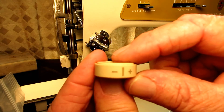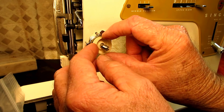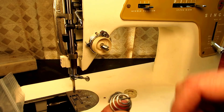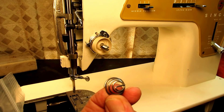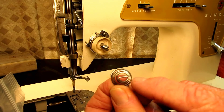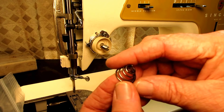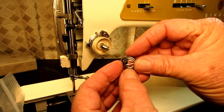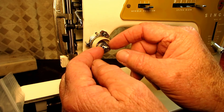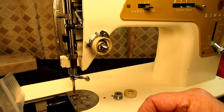Now get this spring up on the spring rest — the little pointy end out here. This is a very good time to do it before putting the other parts on: hold the assembly and fold that spring up and tuck it on the rest. Now it has spring motion because the spring tail prevents the whole spring from turning. Then put the indicator plus-minus on — I suggest you put it with plus-minus up so you can read it. Then put the clean non-rusted tension spring in there.